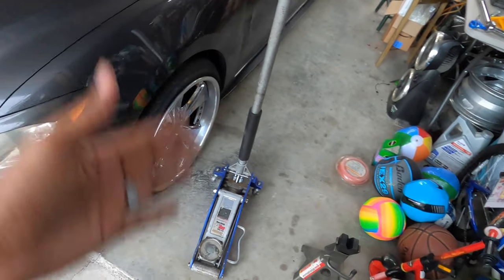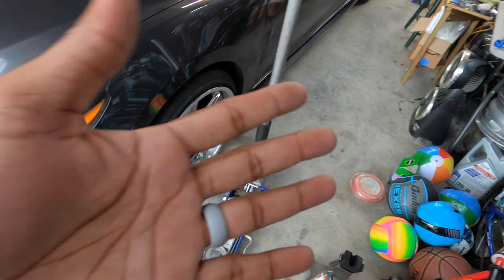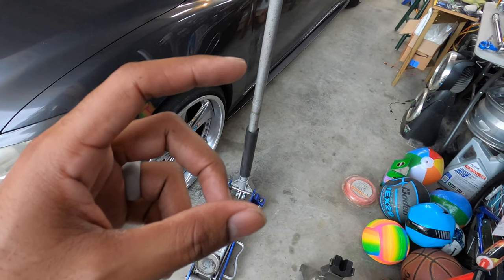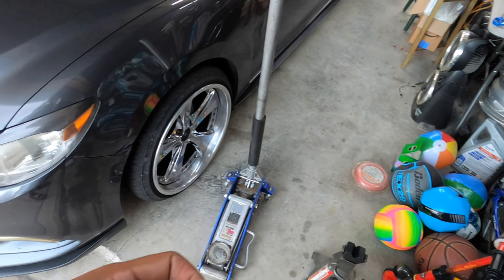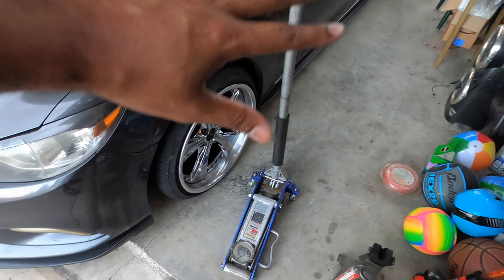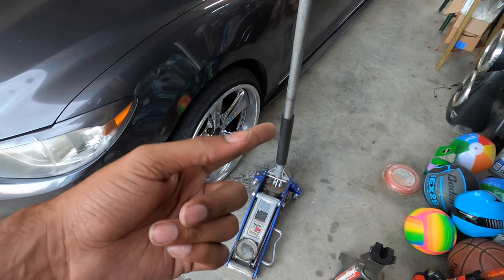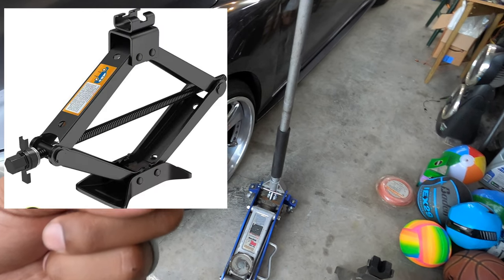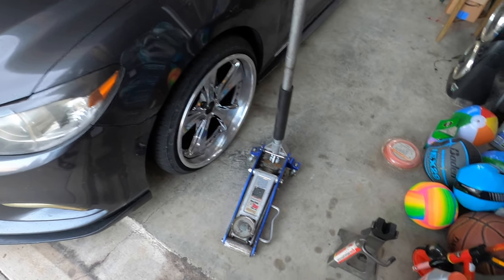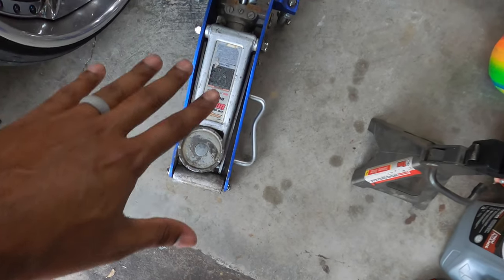First, let's go over some of the basic stuff you're going to need. One is going to be a jack. The car comes with a factory jack but I don't trust those scissor jacks — I had one fold over on me on my '81 Oldsmobile. Bottle jacks I trust; scissor jacks, not so much. I prefer a standard floor jack, so I have a Harbor Freight one-and-a-half ton low jack that I keep in my car.